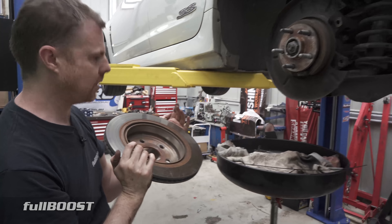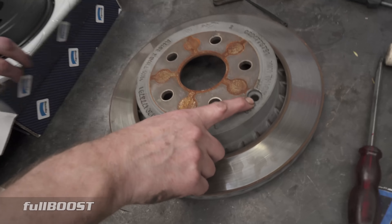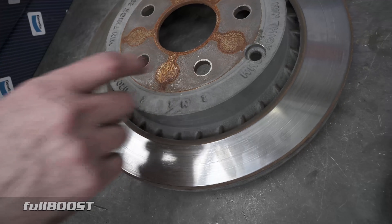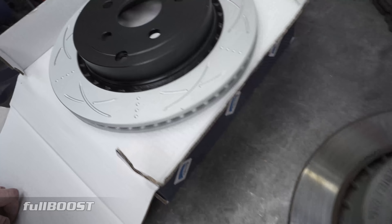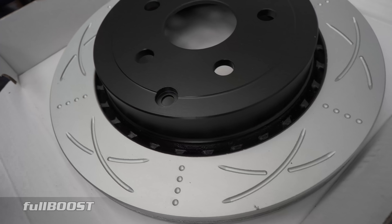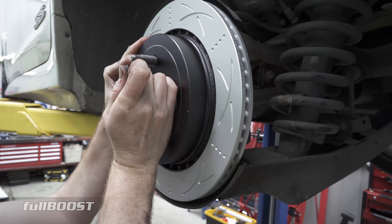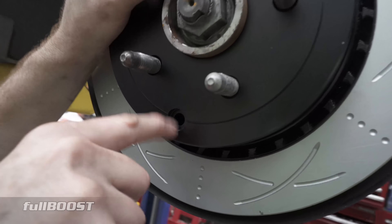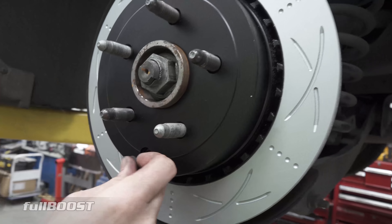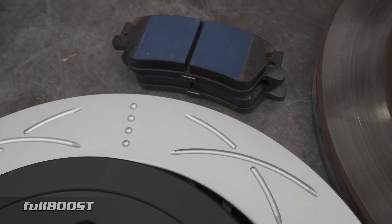You can see a bit of surface rust around the hub here on the face of this disc - that's pretty normal. The easiest way to get this disc moving if it's not budging is to spray a bit of penetrating fluid in there and then, just like a flywheel on the back of an engine, give it some light taps and then we're good to go. There's that internal handbrake assembly I was talking about. So we've got both discs here - this little locator is for internal handbrake adjustments, so you wind it around to where there's almost like a drum brake with a little pinwheel that you flick, and you can adjust them in and out. The new rotors have a nice coated centre with no rust-inhibitor coating needed - same but different, which means they're going to go in where they need to.